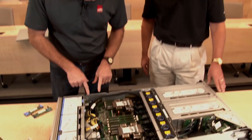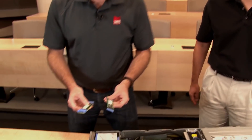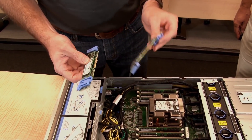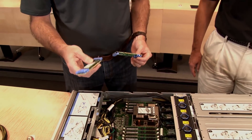Down in the corner is the M.2 adapter. Just like on the rest of our ThinkSystem servers, we have M.2 support, and what that is is a boot drive. Here are the two variations we support: the single M.2 adapter, which supports one M.2 card, and the dual M.2 adapter, which supports two — one on either side. With the dual one, it supports mirroring, RAID 1, with the RAID functionality built into the card. The idea is that you would use the M.2 as your boot device and then reserve the SATA drives as the local data source for the GPUs.